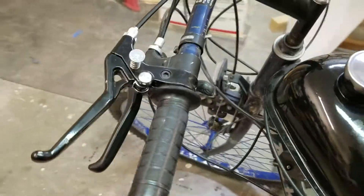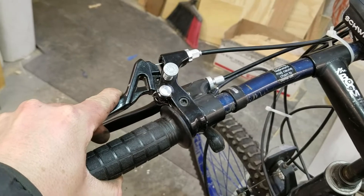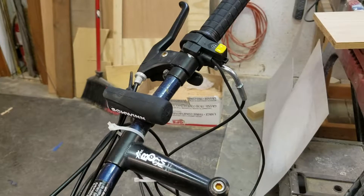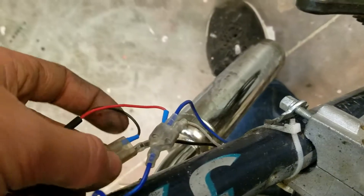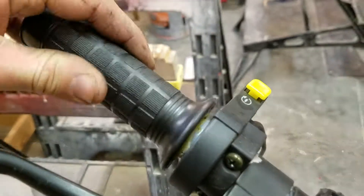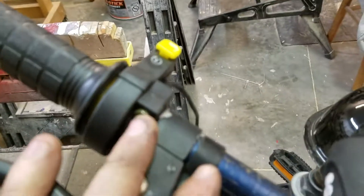Because it's a mountain bike, I offset the clutch a little bit — not a big deal when cruising. When you're cruising, the clutch is up so I still have use of both brakes until I disengage the clutch. The choke works real well, the kill switch works well. The kit says black to black, blue to blue — I put the red and white into one connector and the black to black in the other, and it worked out pretty well. I did have to super glue the throttle cable, and it worked — I didn't have to drill my handlebars at all.